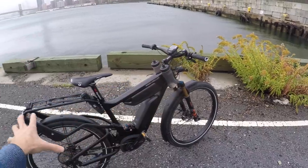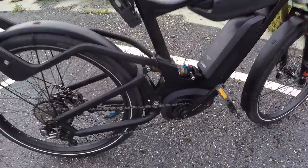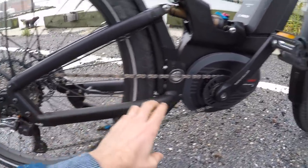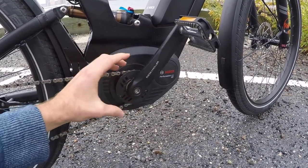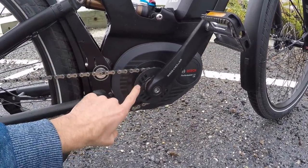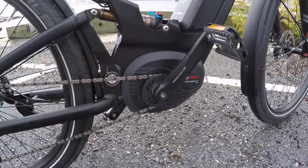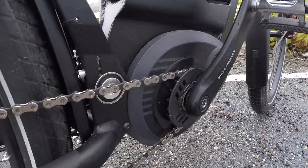Between the fenders and the lights and everything, you can just get out there and really feel safe, which is something I think about. Love that there's this texturized slap guard built right in, because on the Bosch chainring, it is a little bit smaller. This is 18 tooth. It spins at 2.5 revolutions for every crank arm revolution. Very responsive, gets really good grab on that chain. And you've got a Miranda alloy guard to keep your pant leg from rubbing or getting snagged. It helps it slough over the chain, and then it also acts as a guide.